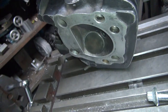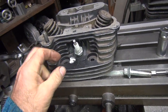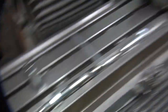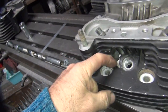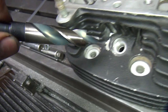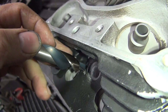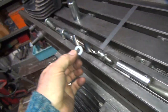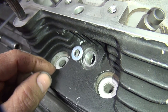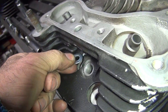If the valve seat falls out, that's not going to help you either. So what do you do? You can drill the head out and play with it more, or not. Right now this head is usable — if I put another hole here it won't be. If I take this set of heads and butcher them, once I put that in there I think I'm going to be in the valve seat, and I think I'm going to cut the side of the port away pretty heavily. What you don't see is how far this thing goes in — on the edge of that line, look where the hole is going to be, look at what this cutter is going to be. The washer is smaller than our surface there, and you can see how much of it is up into the port — it's three-sixteenths into that port. That's probably about all the wall thickness you have to work with.